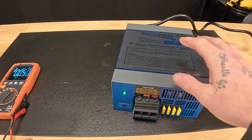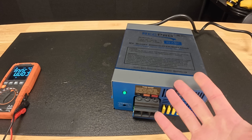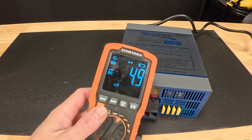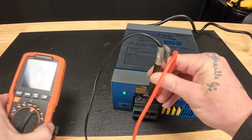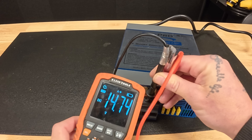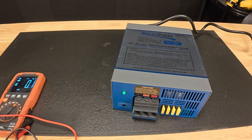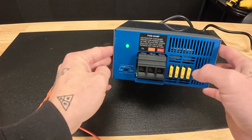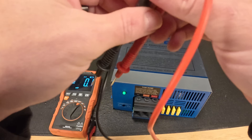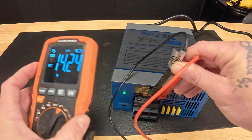Let's say that outlet we just checked had the converter plugged into it. We know there's power going to the outlet, but our battery is not charging. Use that same meter — set it to DC volts — and go to the positive and negative terminals on the converter. We have 14.74 volts coming out of here, which means two things: one, this converter is just fine, and two, it needs to be adjusted to lower the voltage. Some converters have adjustable voltage depending on whether you have lithium or lead acid — you'd use a multimeter to fine-tune that screw until you get to about 13.5 volts for a lead-acid battery.